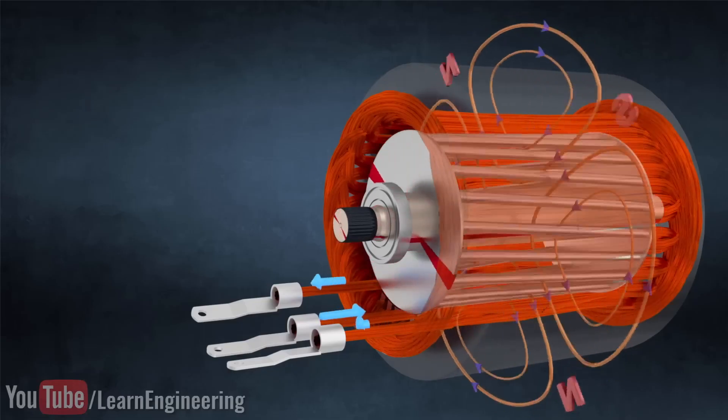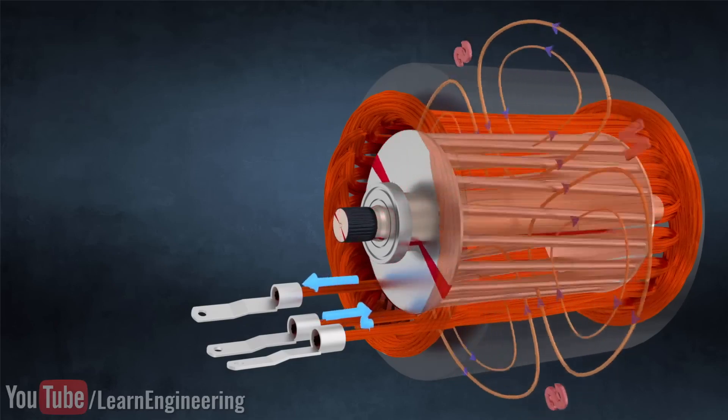On both those models — disc brake and drum brake — we added regen brake. Now, what is a regen brake? It's the ability to turn your electric motor into a generator. Basically, when you shoot current to a motor, the rotor part is going to start spinning and that's going to make you move forward. You can put it on a drone, you're going to start flying; you can put it on a car, a motorcycle, on anything. When you do the opposite — when you start spinning the rotor — it's going to start generating electricity, and that's the principle we apply to do regen brake.